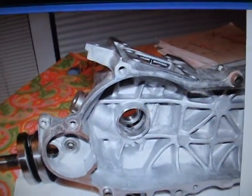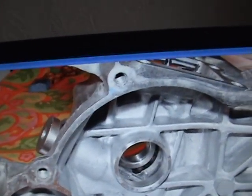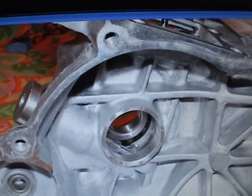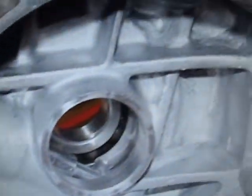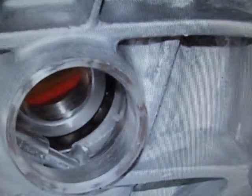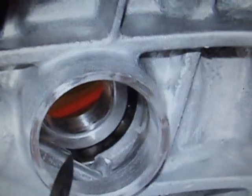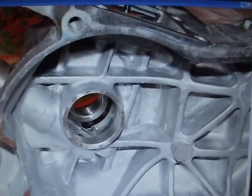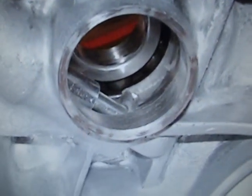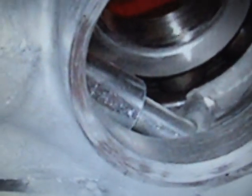Here's the plug again - we're going to go through all phases of this, so refer back to this video. This is the plug - when it's all the way in, it will seat all the way down. This part right here is most important - it's supposed to lay underneath the bearing. Sometimes the crank hits it just a little bit, and I'm not sure exactly why, but it does. So what I do is just chamfer it just a bit so it won't hit.